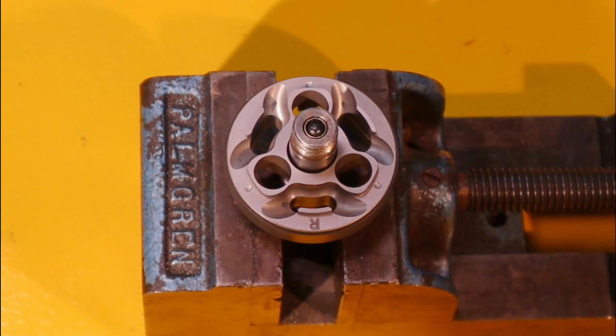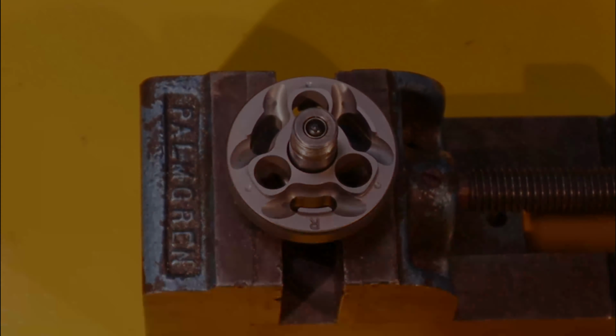It's not a cylinder head. It's a shock absorber. It's a damper. What is damping? What is what we're doing? What we do is the art of restricting flow. That's what damping is. And what you have in your palette, your brushes, your canvas are pistons, bleeds, and shims. And with those, you can paint whatever picture you want.